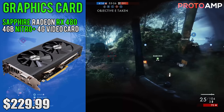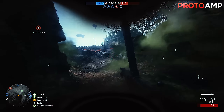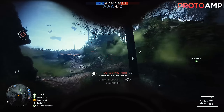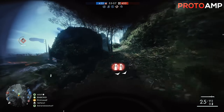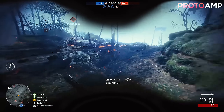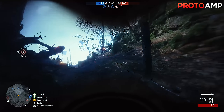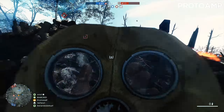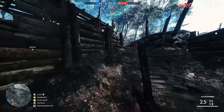For the GPU, we have the Sapphire Radeon RX 480 4GB Nitro+ video card, costing $230. Sapphire is to AMD what EVGA is to Nvidia — it's exclusive to the brand and an excellent choice. The relative performance of this card is about the same as the $30 cheaper GTX 1060 3GB model, with several differences. This card has one extra gigabyte of VRAM, which will help with anti-aliasing, post-processing, and high resolutions — and 4GB is very acceptable. The reason I went for this option over either version of the 1060 is DX12.